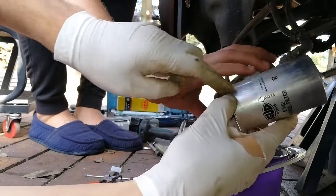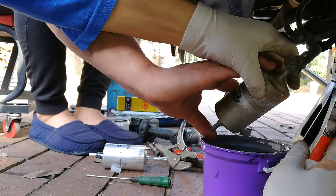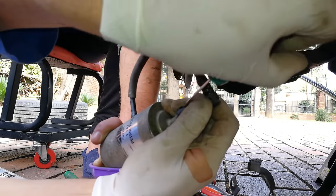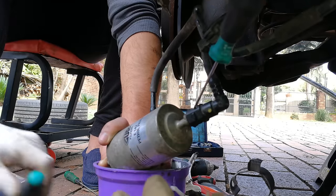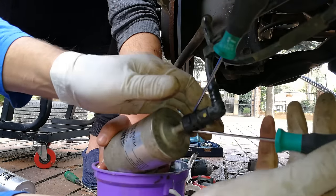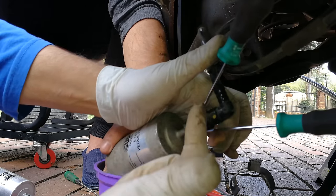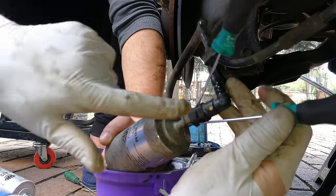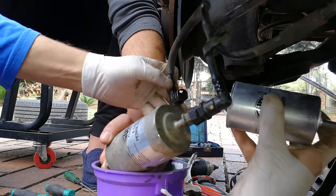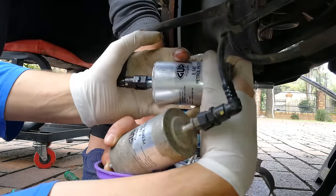Keep in mind the flow direction — remember this is the outlet. Now I'm going to release the top one. I wedged it on one side and then on the other. The fuel is going to be coming through here, so first put the outlet fitting back on so that once I've put the inlet it's not going to be pumping everywhere — and that's on now.